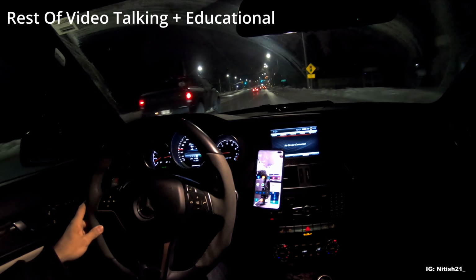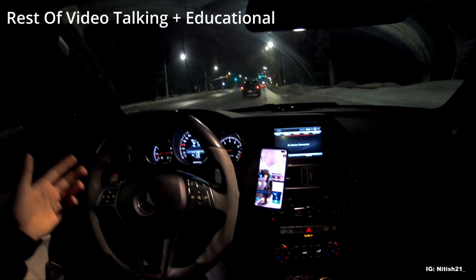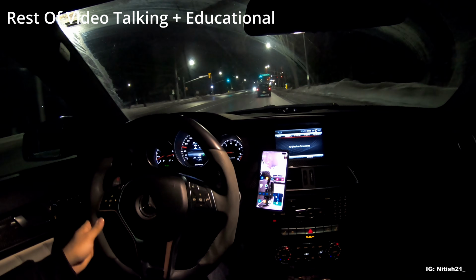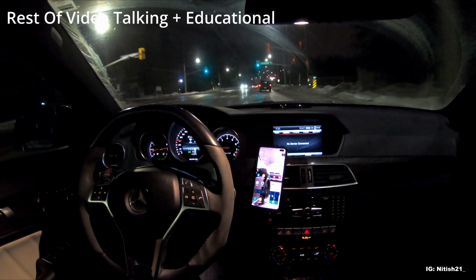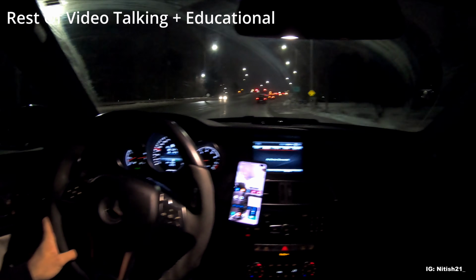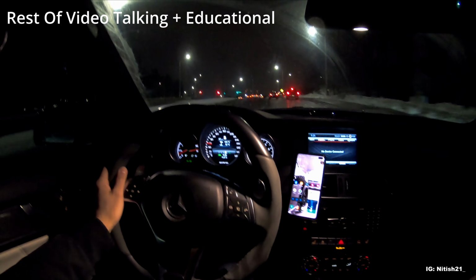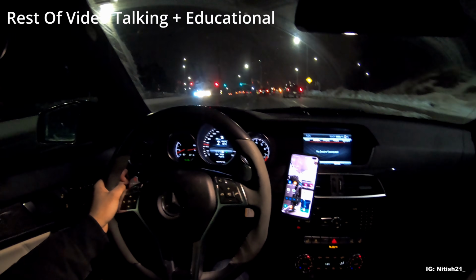The one night he actually ran my G, he popped that motor, but we were prepared for that, and we had already purchased a full set of forged internals, so we ended up building that motor. So now he has a fully built motor in that car, including valve train done as well. It's got a Boost Performance single turbo kit on it with a Comp 6871 turbo and 2000cc injectors.